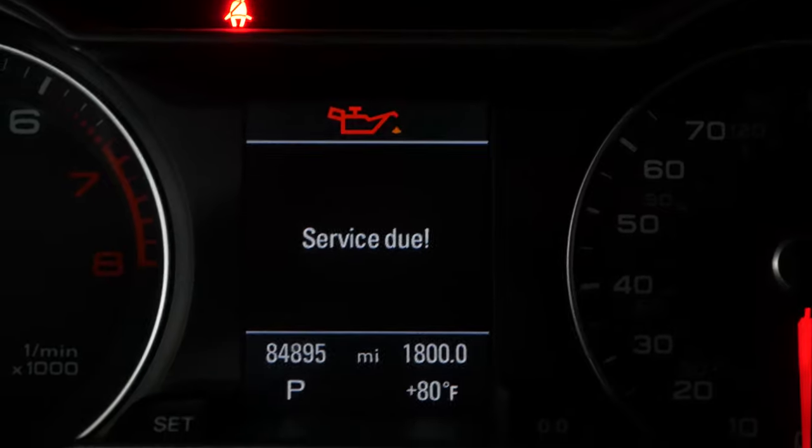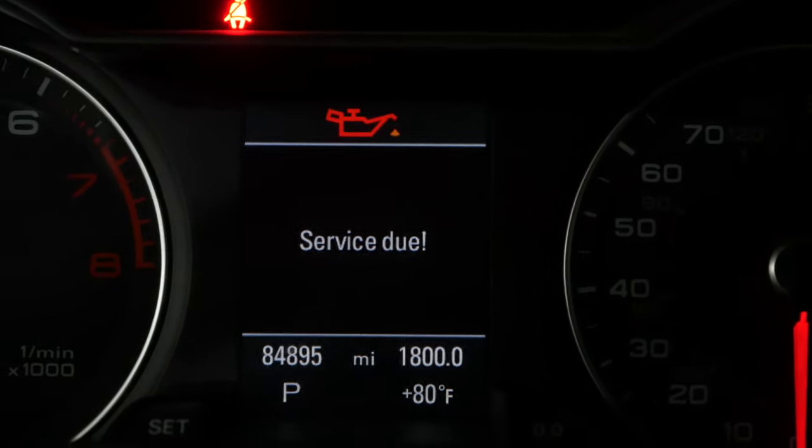It's saying 'hey, we have a problem, you have no oil pressure' — that's on purpose. One thing that surprises me is that Volkswagen and Audi still don't use an oil pressure sensor. If you've been using oil pressure switches forever, and the fact that they had to put two switches on this one to determine idle and higher RPM pressure — I'm assuming that's the reason, though I'm just guessing. It could be pre-filter/post-filter, but since they're using different pressure values I think it's something else.